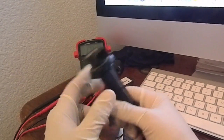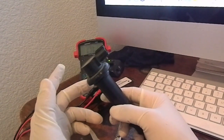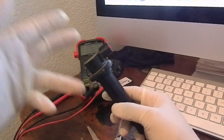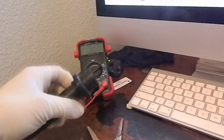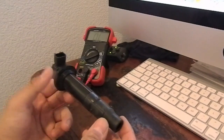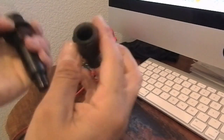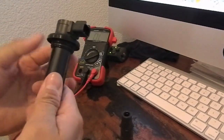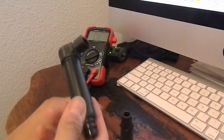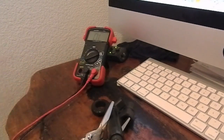That's hopefully going to fix the problem — I'll let you know what ends up happening, because I know I'm not the only one with this problem. It can be hard to pinpoint just because so many things — from bad gas to bad spark plugs to the coils — can all have the same effect. And that's how we do our coil test. One more thing that could be helpful: to make it easier to reach in there, this part can be removed very easily, and the boot also — just to show you the separate parts. That'll make testing the bottom side just a little easier.